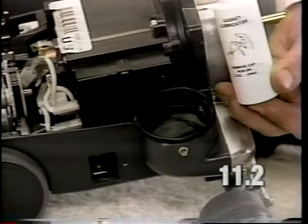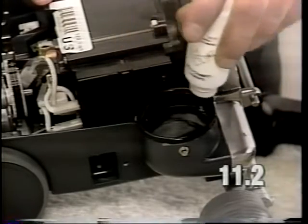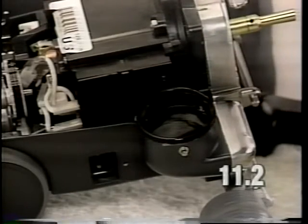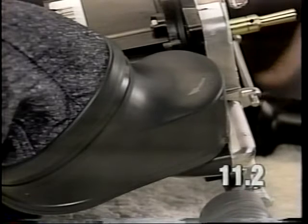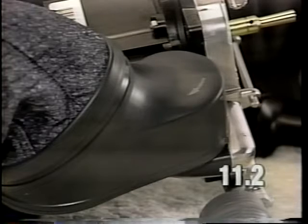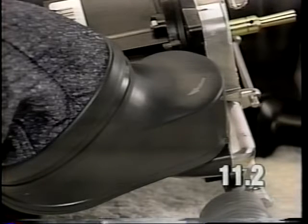Always apply gasket lubricator prior to installing a mini emptor onto the horn gasket. To apply the gasket lubricator, simply rub it around the horn gasket to lubricate it. Then install the bag and mini emptor assembly. Once the bag and mini emptor assembly have been installed, the machine can be used immediately. The bag mini emptor assembly cannot be removed, though, for 96 hours or 4 days after the sealant has been applied to the horn gasket. It takes that amount of time for the sealant to cure.